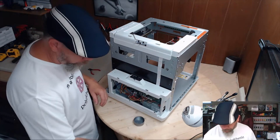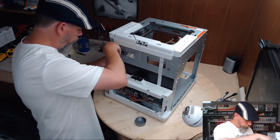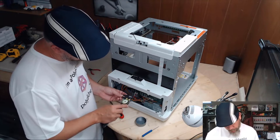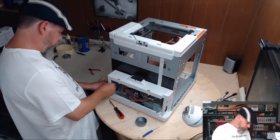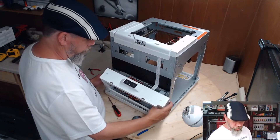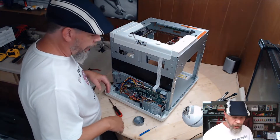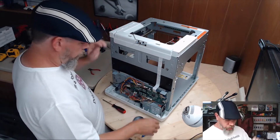Now to remove this bottom panel, you have two more screws — machine screws without the washer, seven millimeters long. Pop this side loose first, then you've got to tilt it so it clears the switch and the power plug. But don't go too far because you've got the filament cartridge sensor still connected. Just unplug it from the circuit board and remove this piece. You won't need that filament sensor anymore — go ahead and sell it on eBay or throw it in the trash.